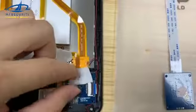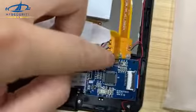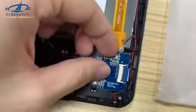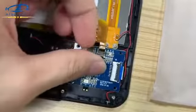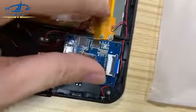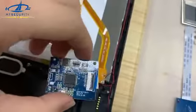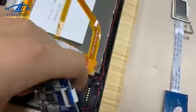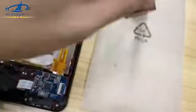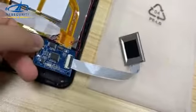To replace the small board, disconnect the cable here — remove this tab, and you can see the connector. Just lift it up to remove the cable. You can now get the board out. Since the remaining part still does not work, we need to replace this with a new working one. Connect back this cable and see if this sensor can work.